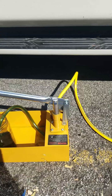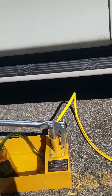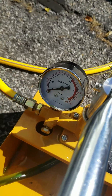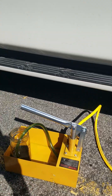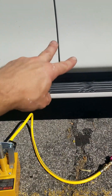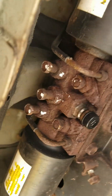I didn't have time to do too much video because of all this process, so I'll tell you quick. I pumped two and a half megapascal to the system, then bled it from the bleeders off the wheels. You have to raise it up, keep it on jacks, attach the hose, and open three valves.